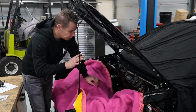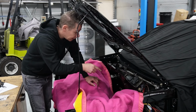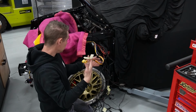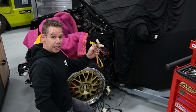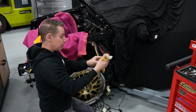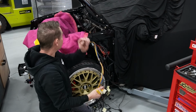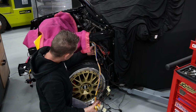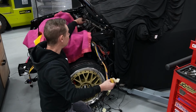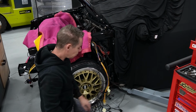So I'm trying to figure out the best way to route the cables and from where we need to start lengthening the cables. And the connectors from the Mark IV are over here right now. Here is the prepared piece, and these are the connectors that go in at the back of the fuse box. And a lot of those, there will be more, will be at this length that they can go to the dashboard, to the fuse box. So now I know this is the length that I will end up at this junction, and then I can try to make the same length all the way to there, get it out again, make those lengths onto this point, and then work our way further.